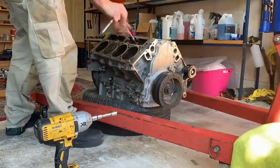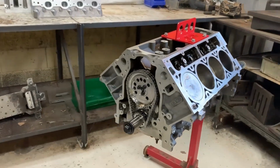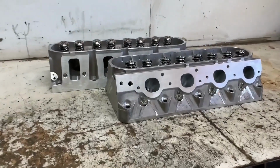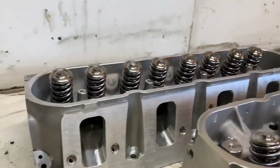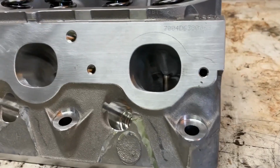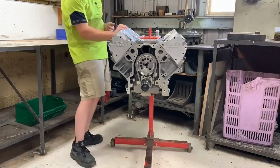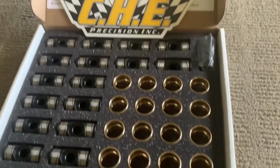The engine was removed and partially disassembled before I sent the bottom end off to Speedworks Engines in Ringwood, where they gave it a once-over and gapped the rings and dialed in the Brian Tooley Racing camshaft with a Rollmaster double row timing set. I reassembled the rest of the engine using Johnson 2116 LSR tie bar lifters, LSA head gaskets, and ARP 2000 series head studs, and a Melling 10295 standard volume high pressure oil pump.